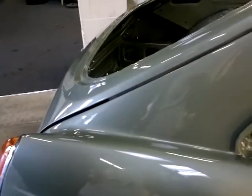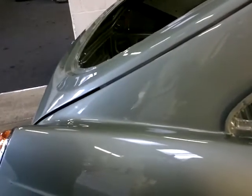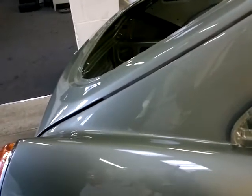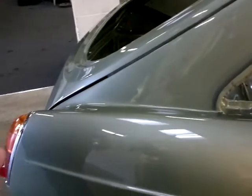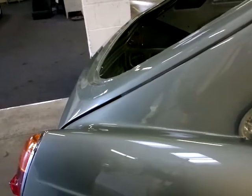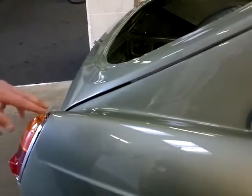So is it fair to say that what you've achieved here at the LE50 is, by ironing out all these known rust traps — they're not so much design flaws as such, but because of the way the cars were originally put together, they're inherently water traps that will always wear the same way on an old GT or a roadster. And getting rid of them — I think you've made the line even prettier than it already was, and you've done away with that kind of maintenance requirement.